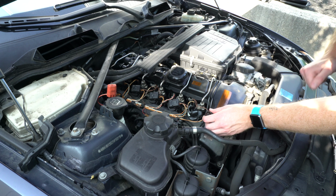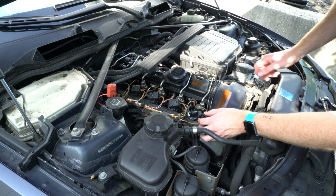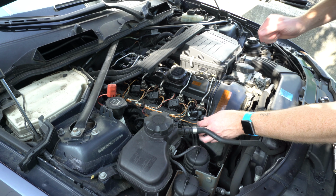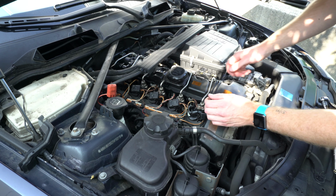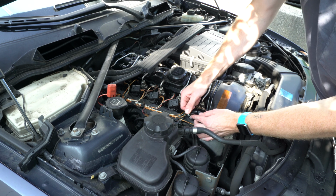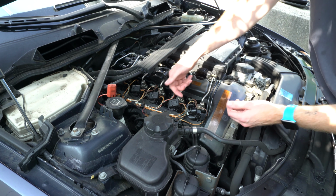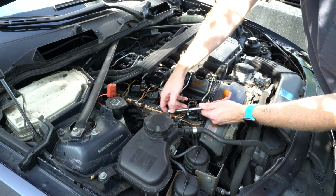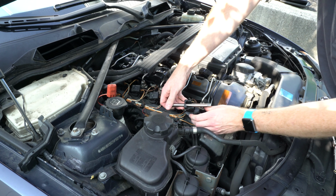Even going back to the M54 engine on certain 2003, I believe, to 2005 or 2006 models, they have the same exact ignition coil setup. Now you can lift these out by hand, which is usually pretty easy, but I've also seen some people place an extension through here, like this, to give you a bit more leverage when removing the coil pack.